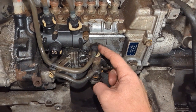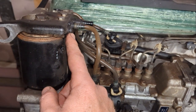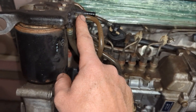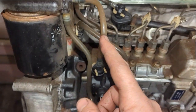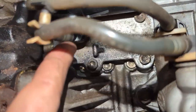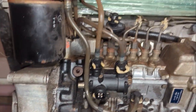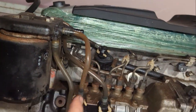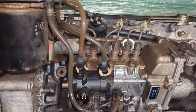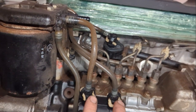It's going to pressurize the fuel and it's going to come out here. From here it goes into the fuel filter, and right here is where it comes out. What we're going to do is go out to the bottom of the shutoff valve — the bottom is right here. You're going to cut off that and cut off right here and put a rubber hose linking the two. After you do that, these two points need to be looped so they're connected.